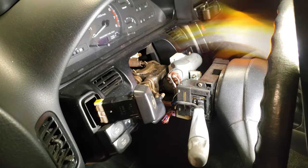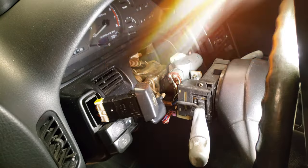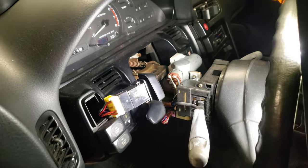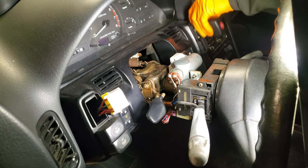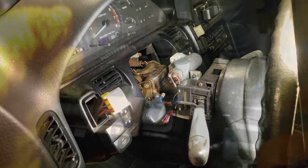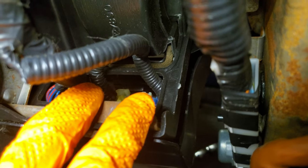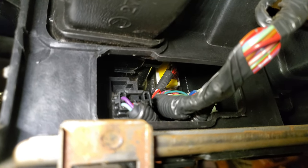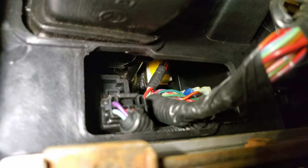But then after that, we moved on to pulling our headlight, our hazard, and our defrost buttons off of the gauge cluster trim. From what we're aware, you can't pull any of the other buttons off like this, so from the backside, you have to really delicately unplug all of the other 4 or 5 buttons, and that should allow you to pull the gauge trim off when the time comes.